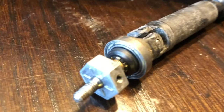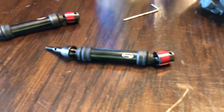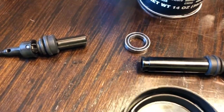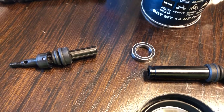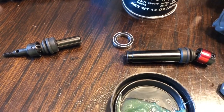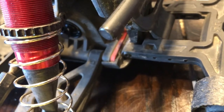There's two sets of bearings on there - the one that goes there and then this little one in here that pushes out. I'll find the right bearings in my kit and swap them out, get everything running smoothly. The Hot Racing axle instructions recommend to grease the splines - I'm just going to throw a little marine grease on there to keep it lubed up and hopefully it lasts long. There's a picture of the grub screw that goes into there. I just got the one greased up, gotta do the other one yet. That grub screw goes right into that hole there on the axle.